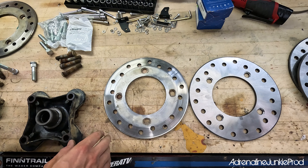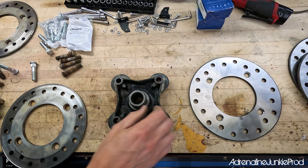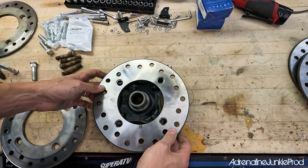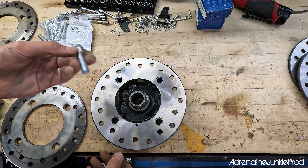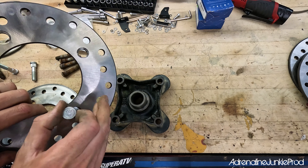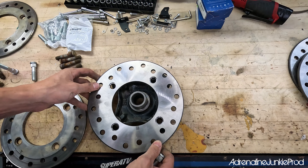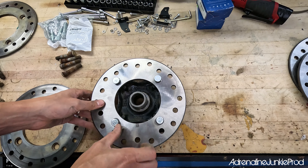So now we see our old left front rotor — we'll get rid of that and replace it with this new one. It literally just lays on there. You have your step sections here where the new stud will sit, just like that. The stud falls through on the rotor and holds in here. They should pretty much self-center themselves in there.